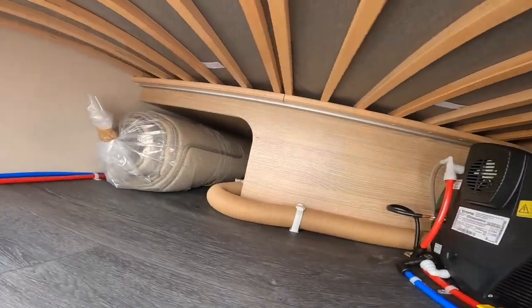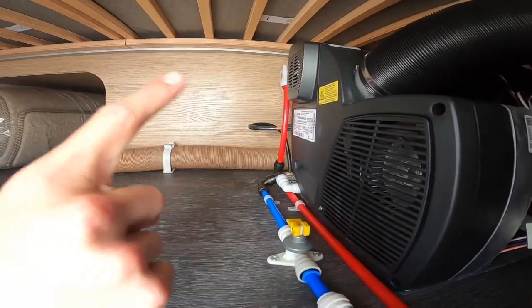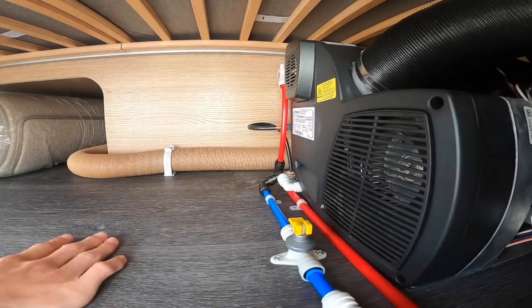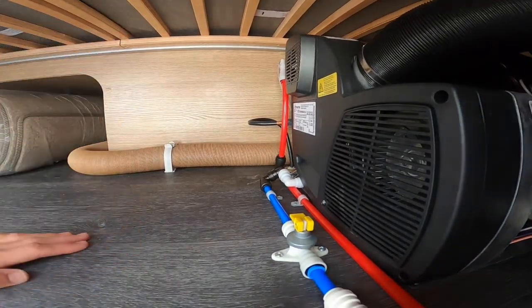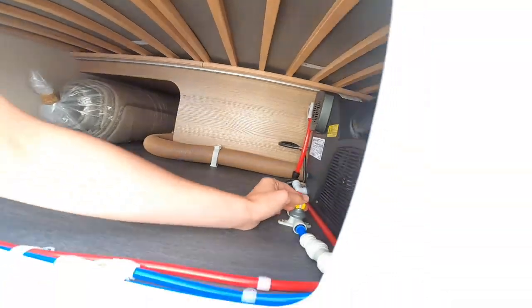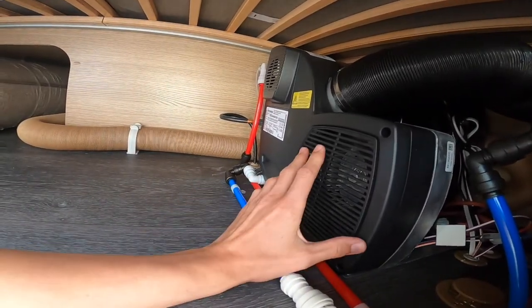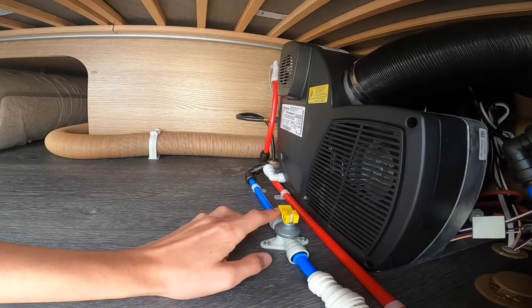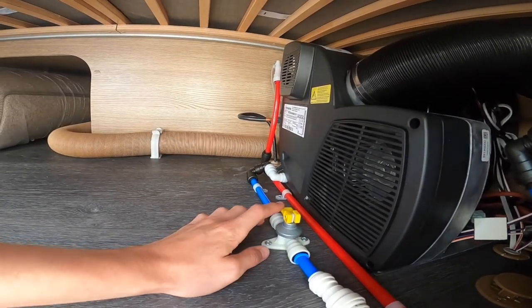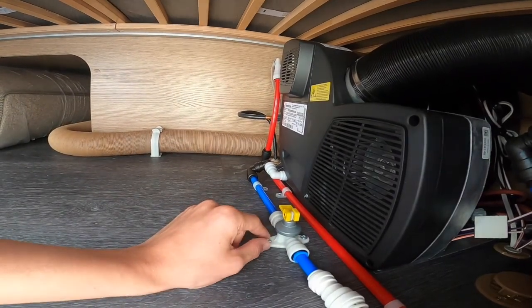In here you've got your under storage and the back lounge, obviously carpets. This is your boiler. It holds 10 litres of water at any one time. In the winter it's very important that you eliminate all water in the vehicle, so you've opened the fresh and the waste from outside. You'll then want to open the boiler, so to do so simply flick this up and you'll see underneath that it's draining 10 litres of water directly out underneath the chassis. Leave it stood up during the time you've got the vehicle in storage, so no water freezes in here, because if it does freeze in there, it voids any warranty, as it's your responsibility to drain the vehicle off, as frost damage isn't covered.